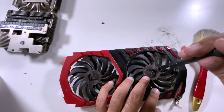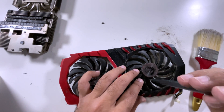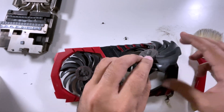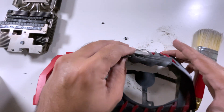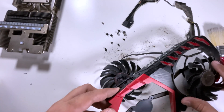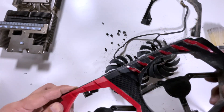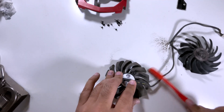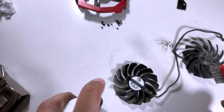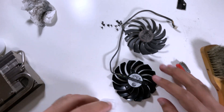To remove the fans from the shroud, you need to remove three screws under each fan. Be extra careful, as applying force in the wrong direction will result in breaking the fan blade and you'll end up googling aftermarket fans for your GPU. After removing all the electrical components from the plastic cover, I gave it a pressure wash and blow dry as well. To clean the fan blades, I first used a dry brush, then alcohol spray, and then wet wipes to clean off everything.